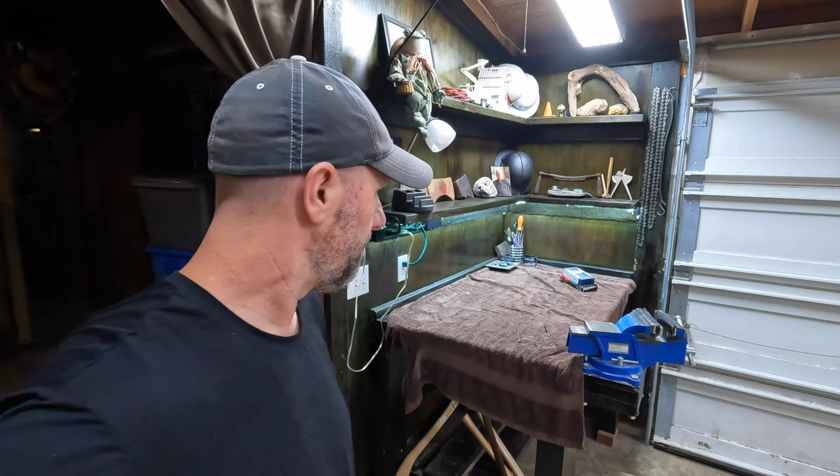It's got an auto tune on it. I'm not the greatest with tuning. I'm learning. I'm getting better. But this thing, I haven't had to do anything with it. It vapor locked on me when I was breaking it in. So I put some heat shielding in here and separated the air from the compartment where I put some reflective tape. I try to keep the heat off the carb and all that. It hasn't vapor locked on me since. I love this saw. You know, I get firewood, let's be honest, I ain't no pro, but this thing is efficient.